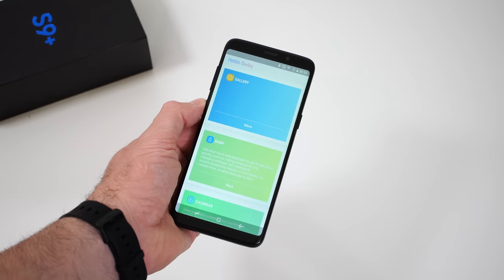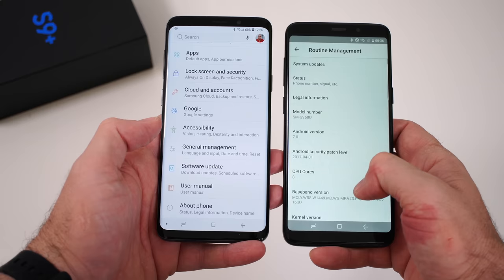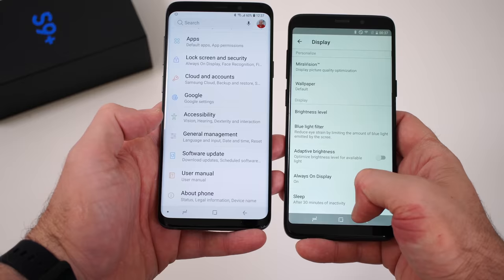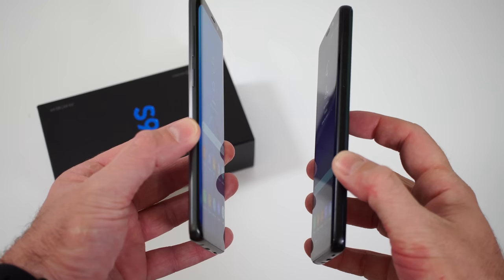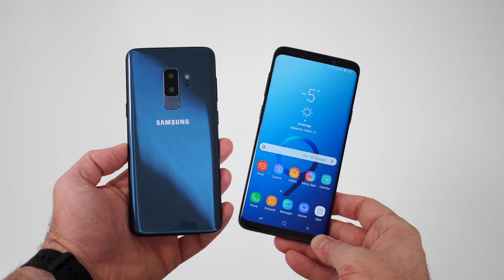If you open the settings app, even though it looks somewhat similar at first glance, if you look close enough you're going to notice that everything is different. We also don't have an about phone section where you can check the software version — that's actually called routine management on the fake device, and if you click on that, you're going to notice that the phone is supposedly running Android 7. You know that the Samsung Galaxy S9 Plus comes with Android 8 right from the factory. If you were to run the Antutu benchmark on the fake Samsung Galaxy S9 Plus, you'd get a score of about 17,000, versus about 260,000 on the original — a massive difference in benchmark results.